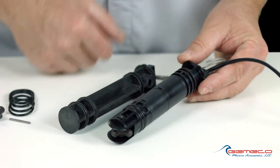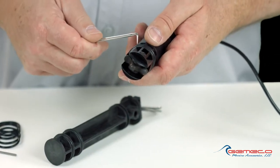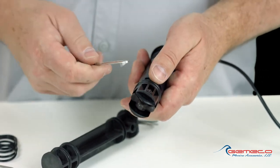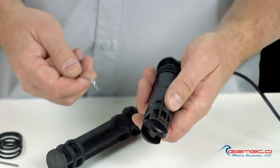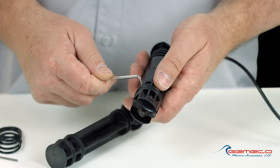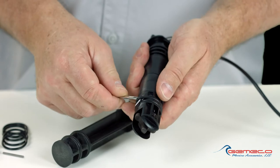So here we're going to start with the lower o-rings. I always start with the highest o-ring first. That way, as you're traveling down the sensor, you don't damage the second o-ring. I'm using a pick tool here. If you don't have a pick tool handy, you could easily use a paper clip — just bend it into a form that works well for you.